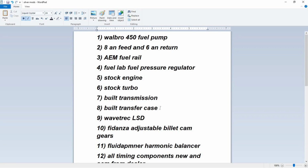Now, you don't tune this directly, but you could tune the AYC. There are separate AYC tunable maps and programs for this, which you can do. But again, I personally feel this requires track data and feedback from how the car is driving on the track. Otherwise, it's really not worth it.